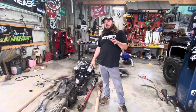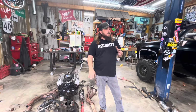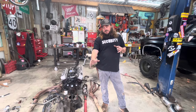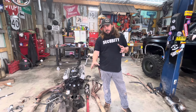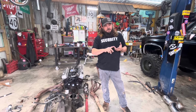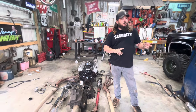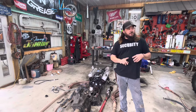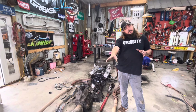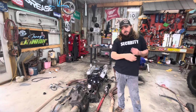And here's an important thing to know. If you're 3/4 ton swapping something, the rear U-joint will be different. Now the front, obviously, is a half-ton drive shaft. The yokes are smaller, 1310, I think, maybe. But if you get online, you can Google combination rear U-joint. There are 2 different part numbers. One if you have a 10 bolt, which this truck had, and another part number if you have a 12 bolt. So you can just buy a U-joint for that drive shaft, because we only lifted it 4 inches, and that drive shaft won't need lengthened. So I will just buy a combination U-joint through NAPA.